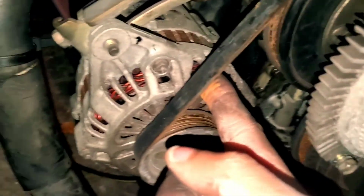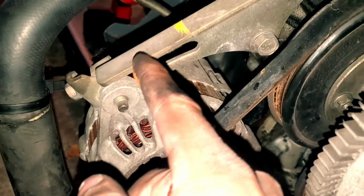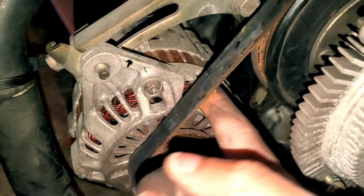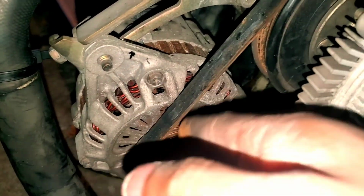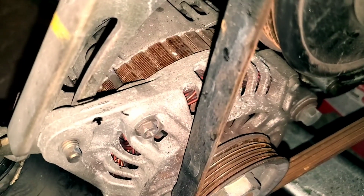And what I figured out for that is you need to untension it through the alternator. You see this bracket has a slidey thing that brings it in. Once that brings it in, tension on this belt goes off, and you can easily just unloop it. So what I did is I went ahead and marked with the same marker. I don't know, it kind of looks like a shadow, but it's right there.